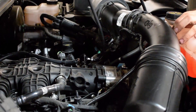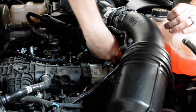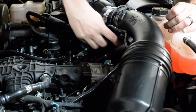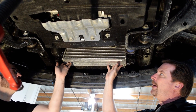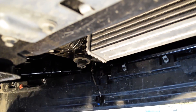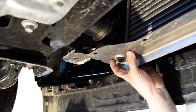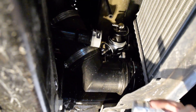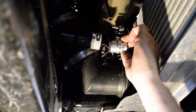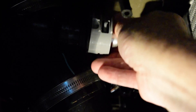Now we'll take our silicone vacuum hose and drop it down in front of the engine to the area where we're going to connect our blow-off valve on the intercooler. Now that we've got our charge pipes reconnected, we're getting our intercooler back up in its spot and reinstalling the intercooler support bracket. We'll install our billet recirculation hose plug using the factory clip — this will keep debris or anything else from getting into your intake track.